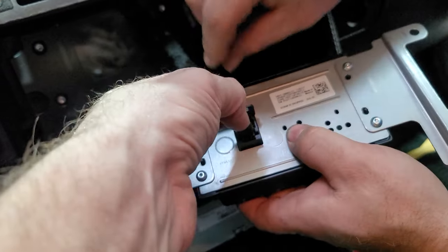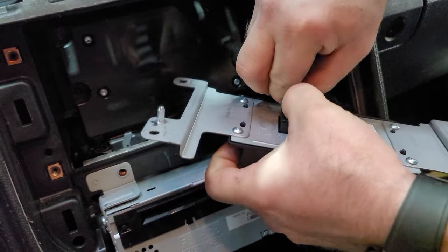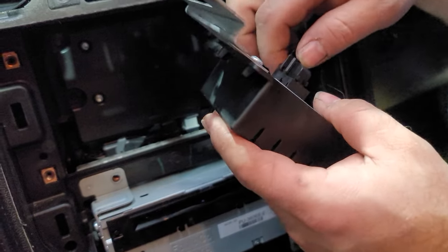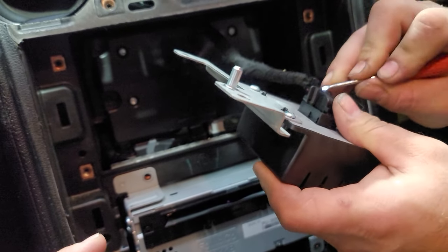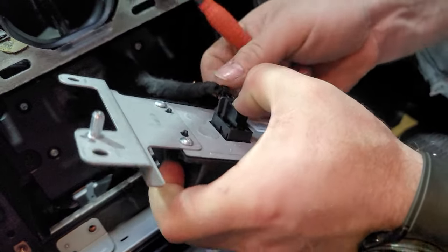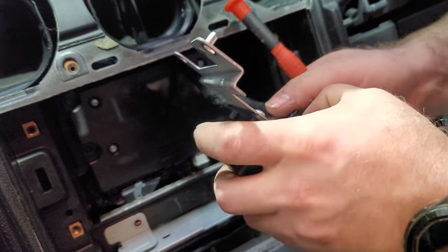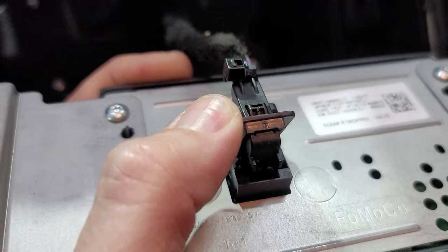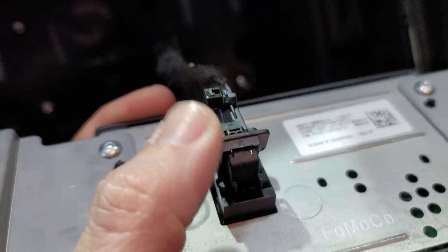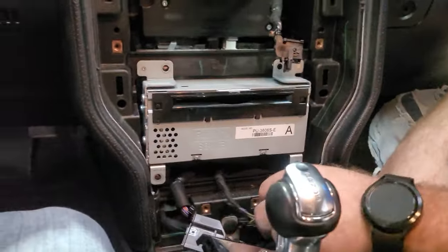This is a European-style plug, so you push down on the middle part — it's a cantilever system. When you push down on that lever it pulls forward and then it'll pull the plug out. Ford makes all their plastic so difficult to push down, which makes it really tough to get these harnesses out. Once you push this little guy down with your screwdriver, the cantilever will allow it to come up and you can pull the plug up — just like BMWs use these. Okay we're ready — we're going to remove the CD portion slot.